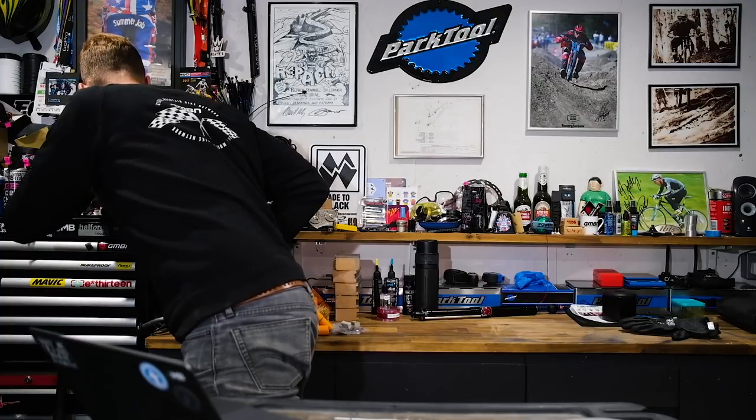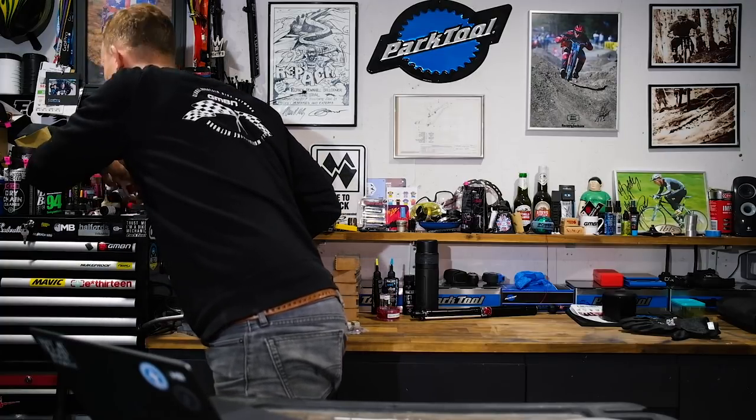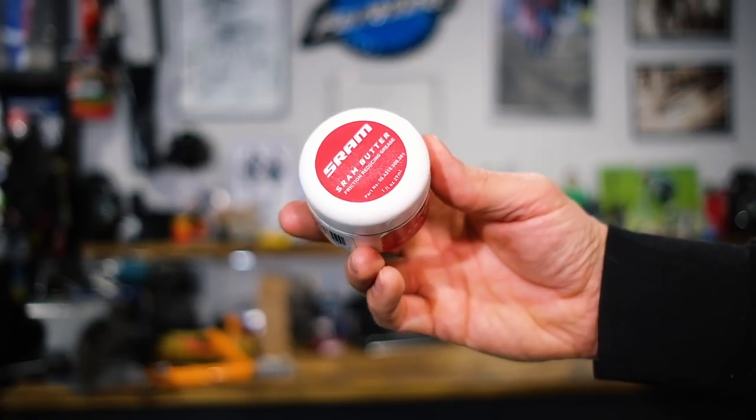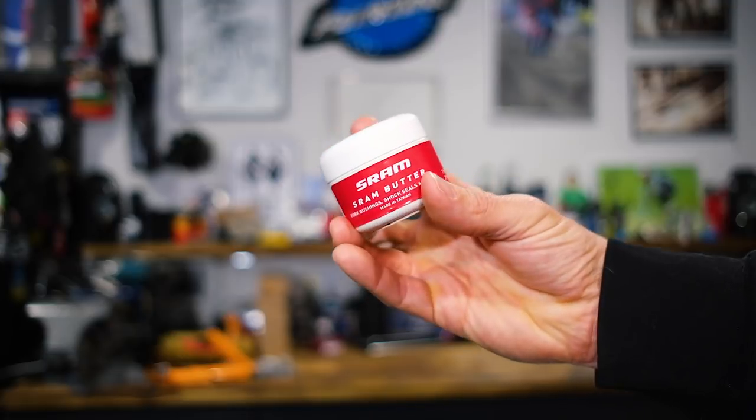Pull them apart, clean them completely. If the bushes and seals are knackered, your best bet is to speak to Full Factory Suspension, TF Tuned, or even RockShox. Trying to find new old stock now, you're going to be looking at dedicated suspension manufacturers who've been doing it since the first time around. Speak to someone like that — there'll be links to both companies in the description underneath this video. The original grease that you used to use on the Judys was called Judy Butter. You can still get the stuff — now it's called SRAM Butter. They're exactly the same stuff, but with a bit more of a boring name. Excellent product, really good stuff. I'd love them to keep the old Judy Butter name just because of nostalgic reasons.